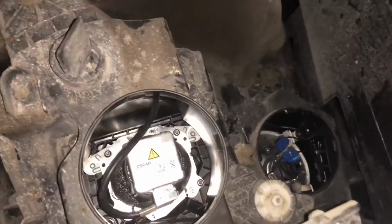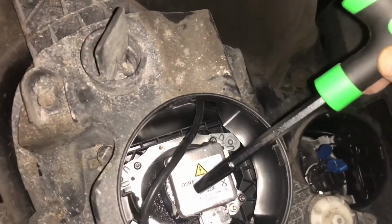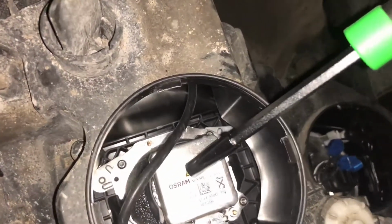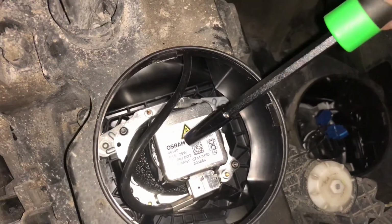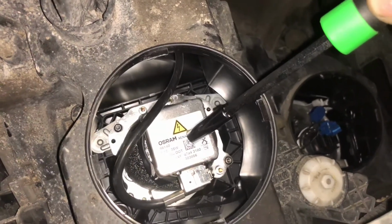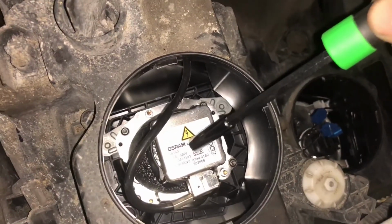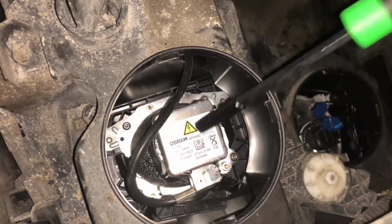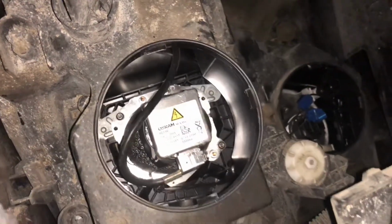But really simple. And if you have halogens, I think it's an H7 projector or something that's going to be in there. So you'll just go to, you know, Lightworks or the Retrofit Source or whatever, and you'll buy a D2S or whatever kit. I think D1S, D2S, and D3S all work with EVOs. And you'll just buy a kit from them that will work with your H7 plug. And you should be able to probably, let's see.